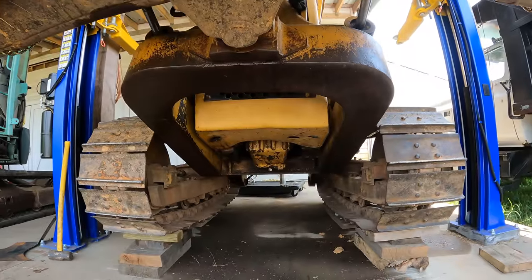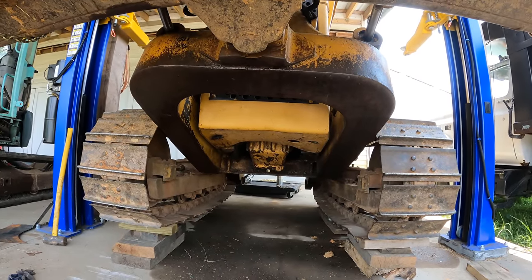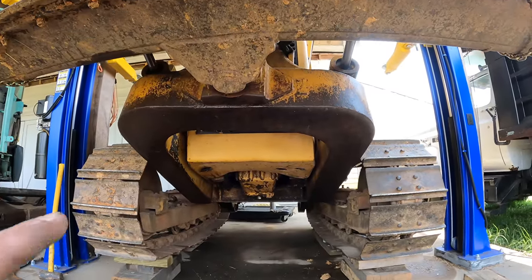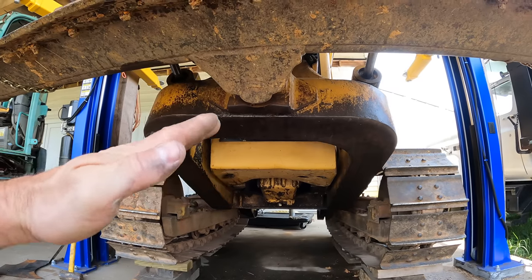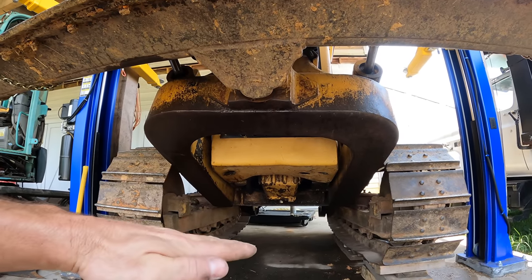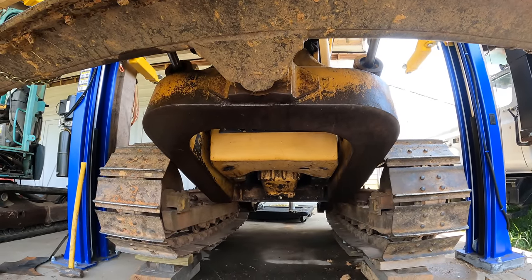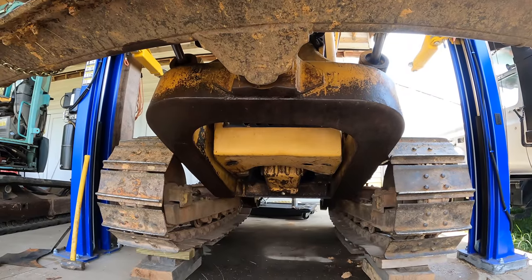And now I bet you can see the problem. That is the oil pan for the engine. There's no skid plate under here. This right here is about exactly where, if you went up over a little rise and then you top center over, you're gonna come down right in that area. And if there was a rock there, it would just break your oil pan. All your oil would come out and you'd probably lock up your engine before you knew what had happened.